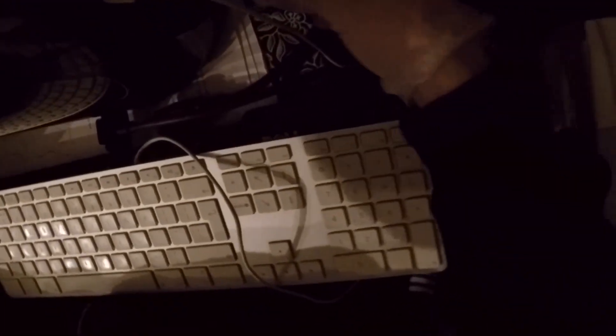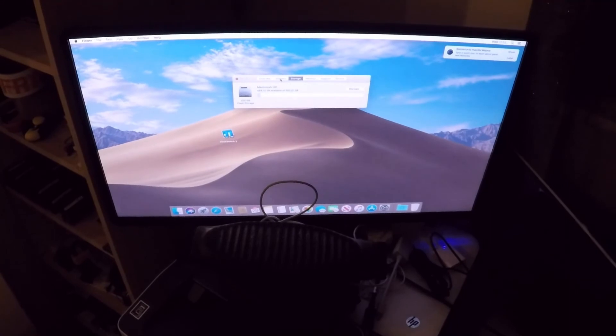As you can see, I've plugged in everything except the power cable. When you first use the power cable after a CPU replacement, the Mac Pro will start up straight away. So when you plug in the power cable, make sure everything — including the keyboard — is already connected, because you'll need to perform the PRAM reset combination immediately. I'll leave a link in the description for that, to make sure you clear the Mac Pro's memory and hear the startup chime.